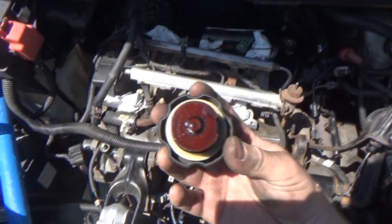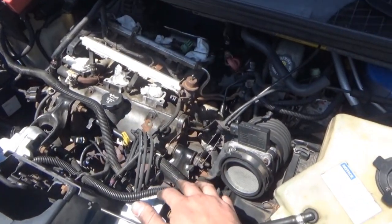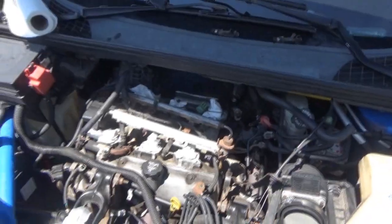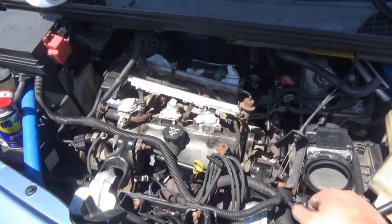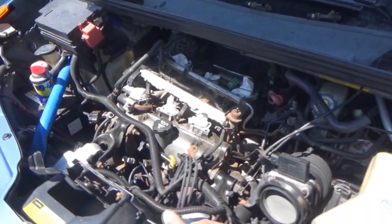We've been keeping the oil changed so there's no more gook or sludge coming out of the engine. Obviously cleaned up everything as best I could on the top. The only thing I couldn't do was the block — I couldn't do anything with the pistons or the rings. I don't think it would be the rings because it's not burning oil and we don't have any smoke. Maybe we have a bad valve. I did lap all the valves when they went in, but maybe a valve is slightly hung up. I'm hoping the fuel injector is going to be the issue.